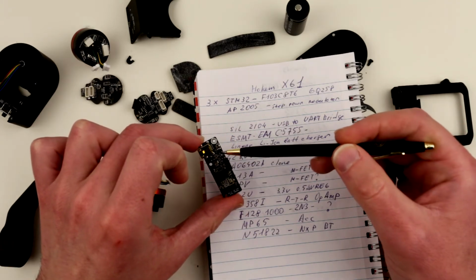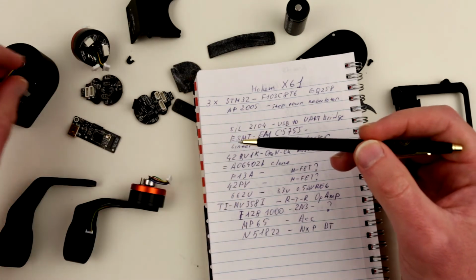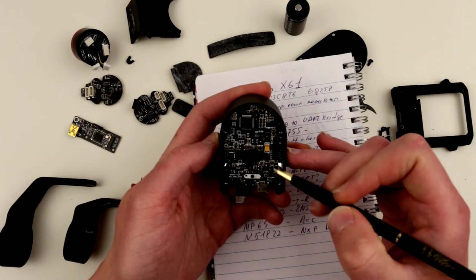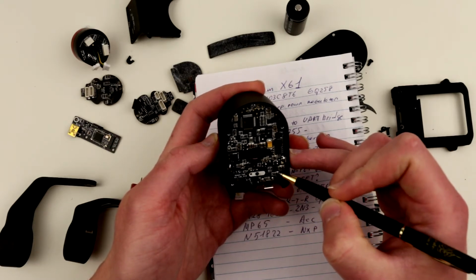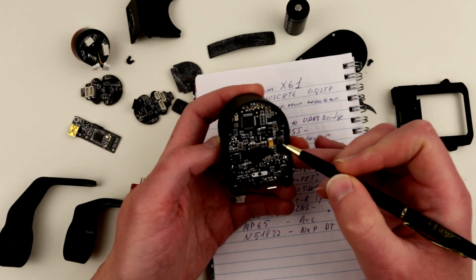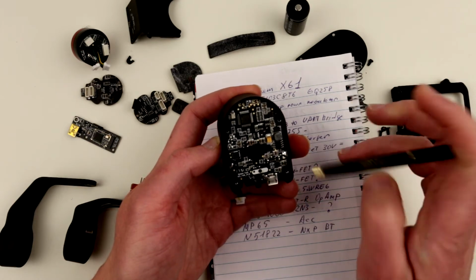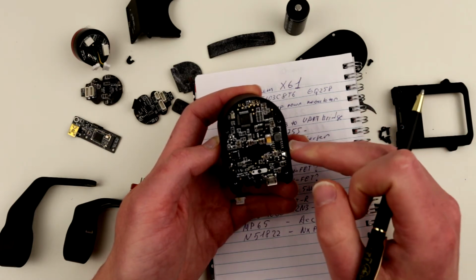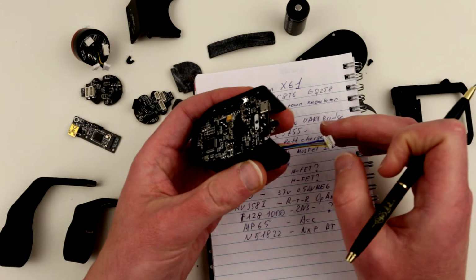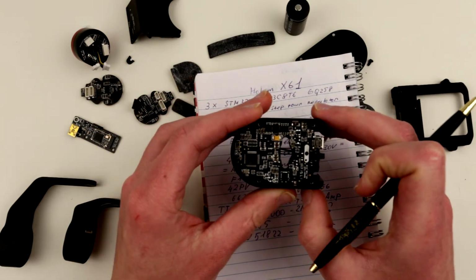have 5 volts. So yeah, where is that thing? I'm not sure, maybe. There's only one inductor I see here, so this is probably the one used for making it 5 volts. But then I don't know why this guy is over here, which is a step-down regulator. It's all a bit confusing because I don't have a schematic of all this.